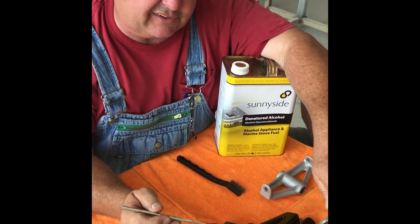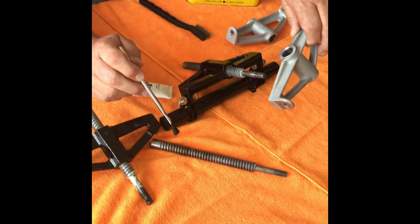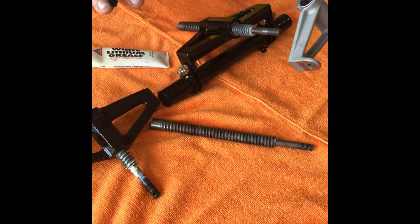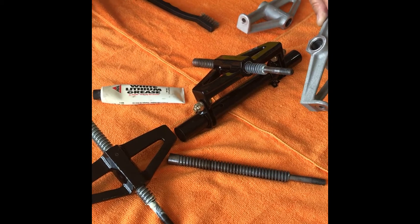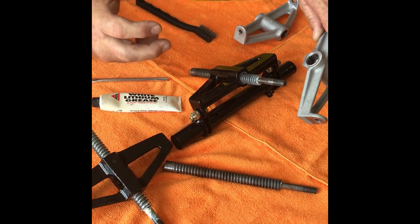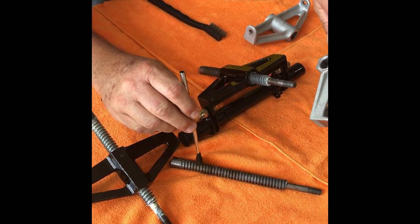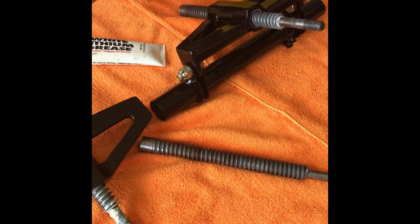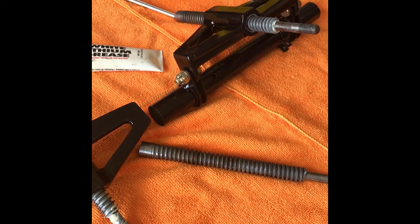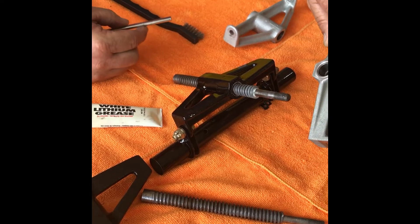Every annual you should go in there, put rags down inside your fuselage, take your little covers off your yoke, and run this thing up and down. Use a rag with cleaner on it and clean all the way down inside the grooves of the jack screw — run it up and down until you get all that old grease out of it.